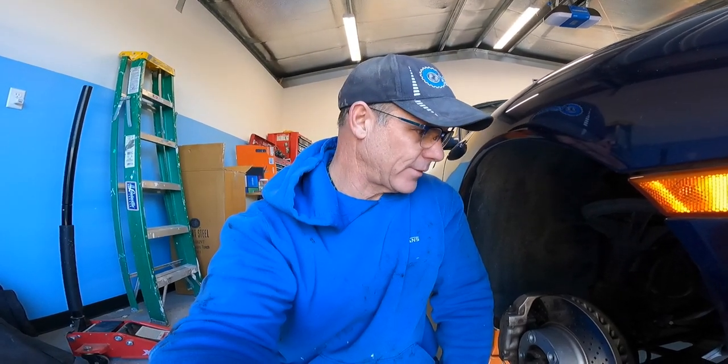It's not very difficult. Really, it took the longest to get the car up on the jack stand and to get that plastic cover off the bottom, because I didn't really know how to remove those clips. So I'm gonna get this other wheel on, and take this guy out for a drive and see if it's affected my clunk at all, if it's gotten rid of it. And I think I'm gonna have to order some shocks, and I'm gonna go with the original Bilsteins, the B4s, even though they're more expensive, it seems, than the B6s or B8s. All right, so I'll check in a little bit.